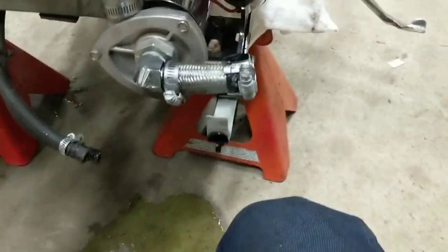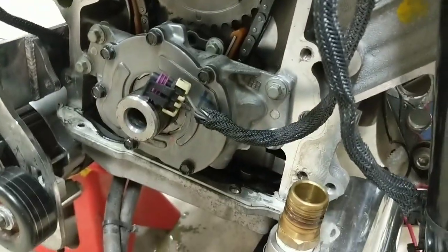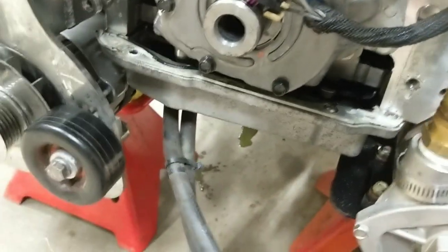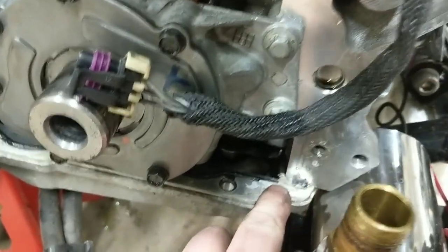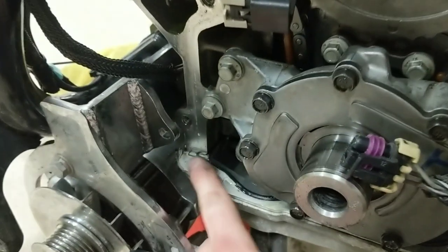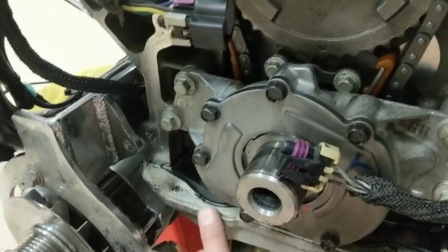I've already had this apart before — I had to pry it off initially. It's a 2012, so it's been on there for eight or nine years. It is stuck on there, and like every LS, there's a little bit of RTV on the bottom corners where it meets the oil pan to help seal, which will help hold you up as well. Now we get to the oil pump assembly and the cam gear. An LS3 does have a cam tensioner — most Gen 4 motors do because of variable valve timing on the newer ones — obviously this one does not have VVT.